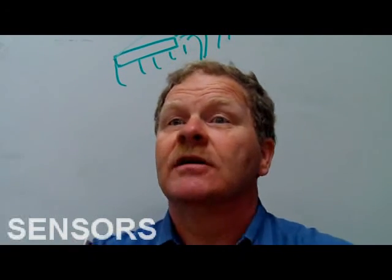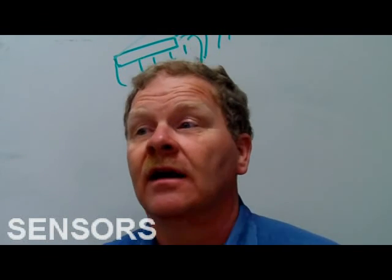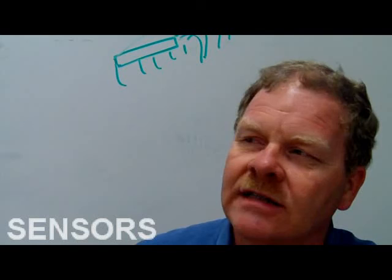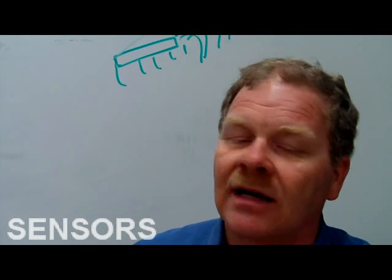I know how fast these ought to be turning in third gear, and I didn't see third gear. Or whatever I was telling this thing to do didn't happen, even though I don't see an electrical problem with it. So there's something going on down there. That's a performance fault. It's not electrically bad, but it's not performing, and that's what you need to look at there. Sometimes you'll look at these codes and say, "What the Sam Hill are they talking about?" All right, but that's what that means.